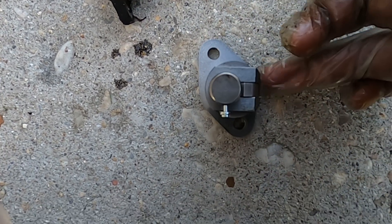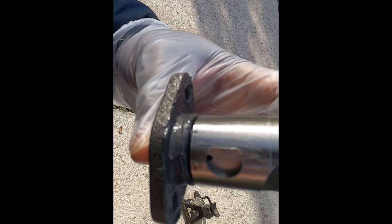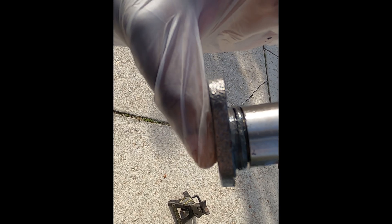I am going to do a little touch up. I might put some gasket maker around here as a secondary seal, just so this doesn't leak again. Put a nice little coat of Permatex Ultra Black Gasket Maker — just a preventative seal. So even if that rubber gasket leaks, it shouldn't go past there again.